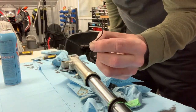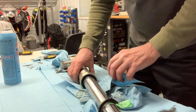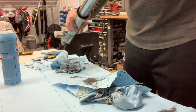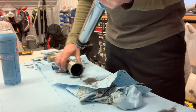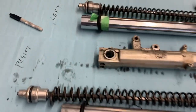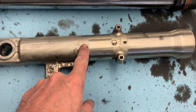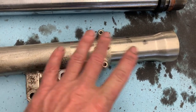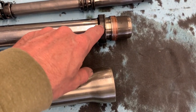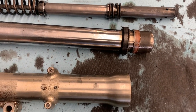I'll take out the little spring that sits on top of the seal. Once that's out you can basically slide it and use it like a slide hammer, and then she comes apart. Everything's disassembled — I lay the parts out so I know which is left and which is right. The next job is strip-cleaning inside and outside, stripping, refinishing, and then once everything's dry and ready I'll remove the bushings and seals, put in the new ones, and get them reassembled.